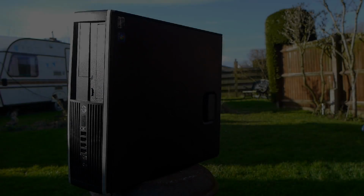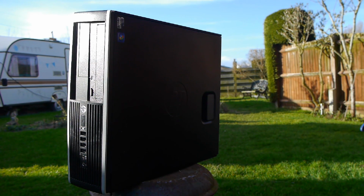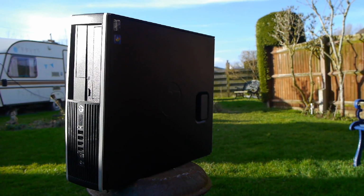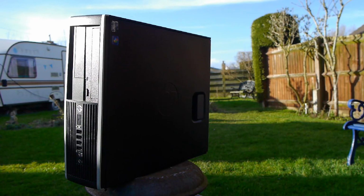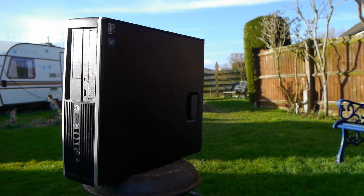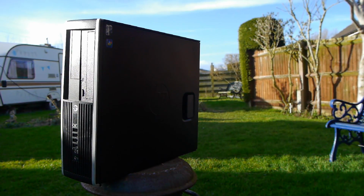So in conclusion, I came into this video thinking that it was time to retire the Core i3 SFF builds and move on to new pastures with the Core i5 minimums and the likes of an RX 550 or GT 1030 as a minimum GPU to stick in it. But in all honesty, I'm pleasantly surprised. It proved that for around £50 you can build a PC by just picking up one of these on an eBay auction or at a local warehouse, sticking in whatever decent low-power GPU you can find, as well as a little bit more RAM, and you're good to go.